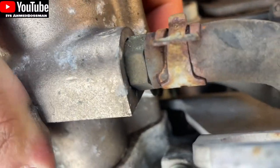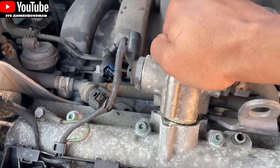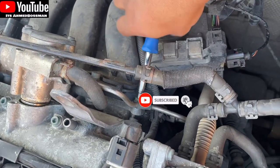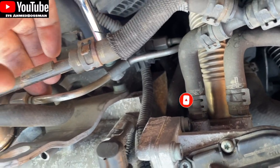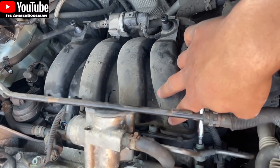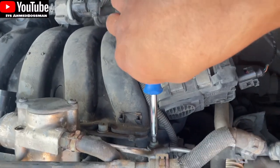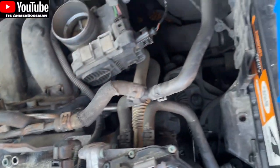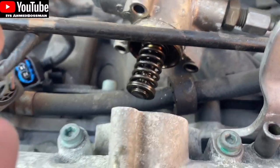I'm just laying them down on the scuttle. You can lift it up a little bit but it won't come all the way, so I've loosened it so it comes up - that's fine. There's a pipe that goes on the air intake manifold, so I've moved that out of the way. You can see it clips in here at the bottom and on the other side as well. So I've lifted that out of the way, and there's one more bolt that has the metal pipe to it, so I need to remove that to get the clearance to pull out the fuel pump.